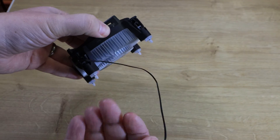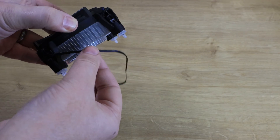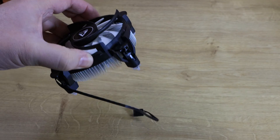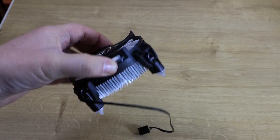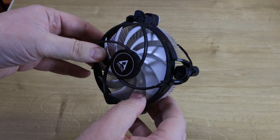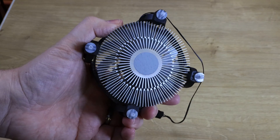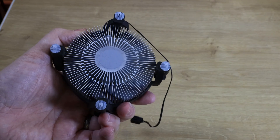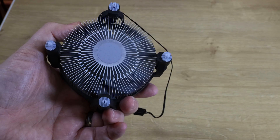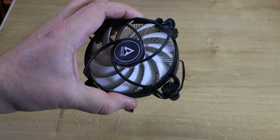You've got that 20-centimeter cable — it's a standard four-pin PWM cable. It's a flat black cable, so there's no snagging and it should be easy to route around your PC. Not that it should have to go far, because you'll only be plugging it into a socket right next to your CPU. You can see straight through it. It looks pretty good, and you've got that pre-applied MX4 thermal paste. I would have liked to have seen the newer MX6 or MX5 paste on there, as you can drop a couple of degrees using those, but that's something you may want to add yourself.